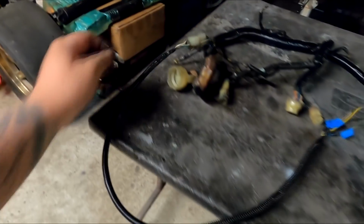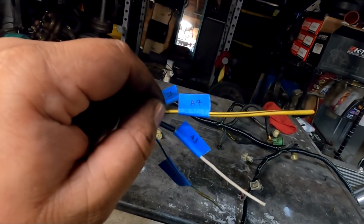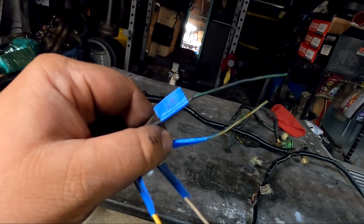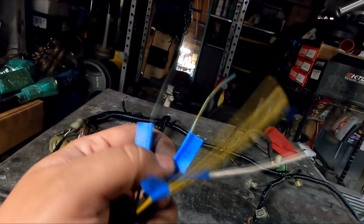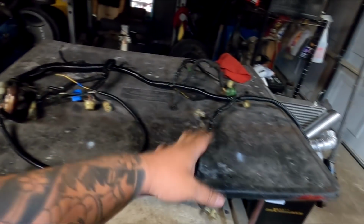I don't know, but this is long enough to go inside the car for the ECU, and the 2 injectors we got right here is for the A3, A7, and then there's a process where you got to move C1 and C2 over to B10 and B12, and then these are the new wires that's going to be going into C1 and C2. So inside the car, it's just 4 wires, well 6 in total, but the harness is ready. I mean, it's almost ready, 99% ready to go.